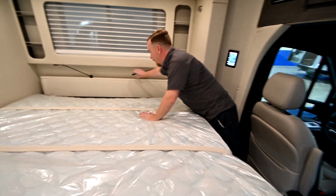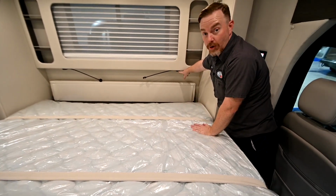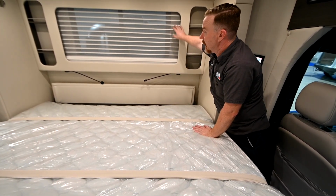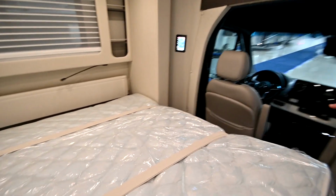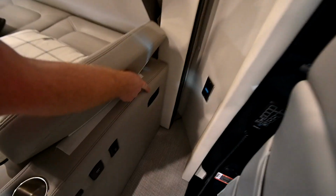Below that, you have your generator. You can also start and stop the generator from here. But before you use this control, you will want to make sure that the red button is pushed in on the main generator control. Otherwise, the control on the Firefly system will be disabled, and it will let you know that you need to turn the red button on. That's what this little warning says here.